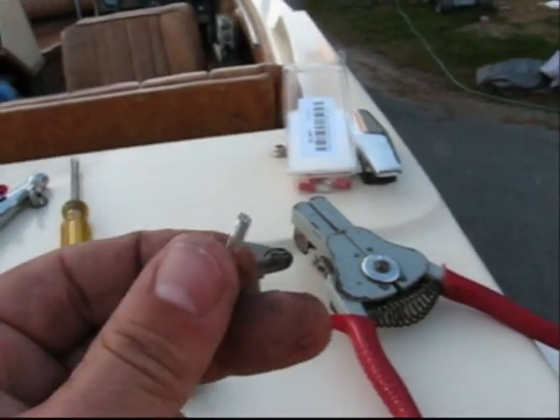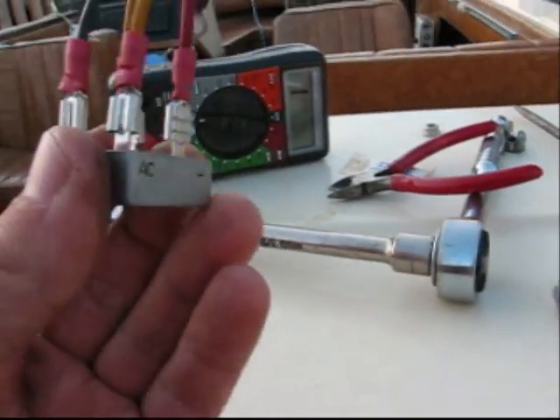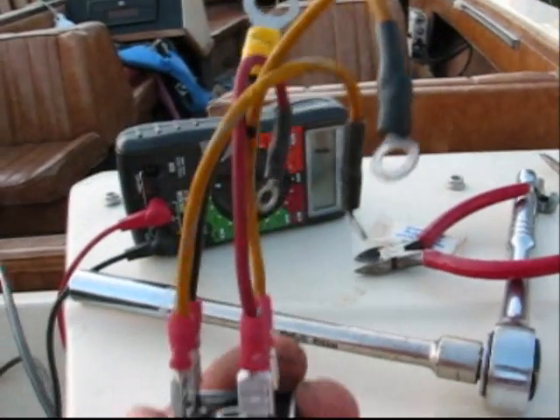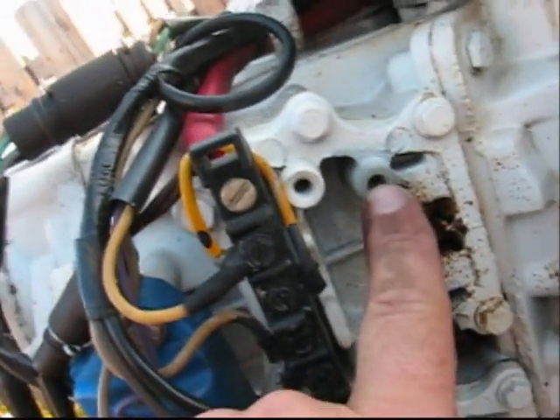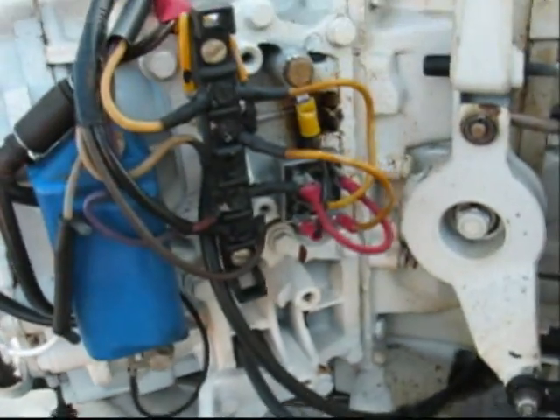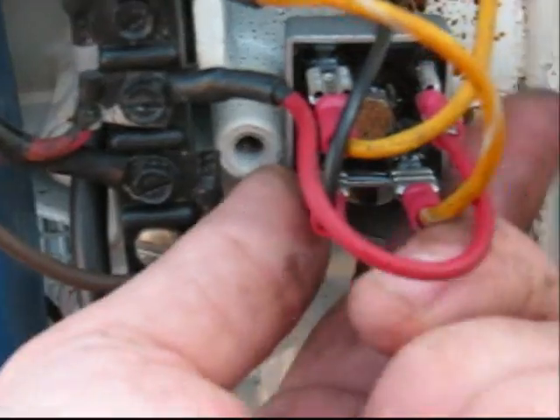All we did was take the new rectifier, take the old rectifier — which is now a paperweight — and cut the ends off. Bought ourselves some crimps and hooked up the new rectifier. We've got AC on one side, which is yellow, AC on the other side which isn't marked, negative going to ground on a black wire, and red going to the positive. We're using a smaller bolt as the ground bolt. Mr. happy is all hooked up — nice rectifier installed, yellow wires in, red wire and ground going to the bolt, bolted in nice and tight.